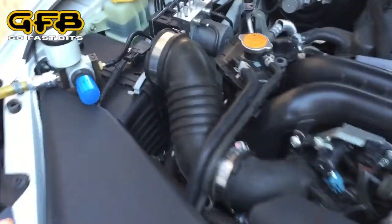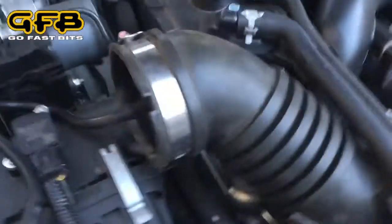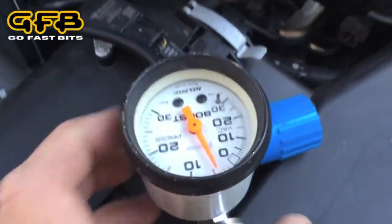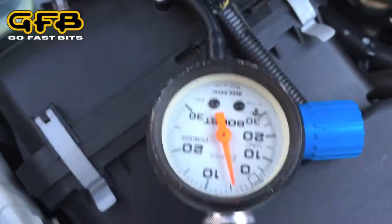We're going to do a quick pressure test on the intake. We've got a bung on the inlet which is hooked up to our pressure reg. We've only got about 5 psi going in there — that's pretty much all you need. You don't want to put super high pressure onto the intake.